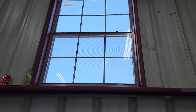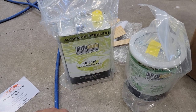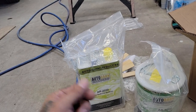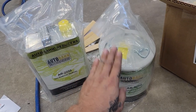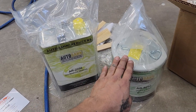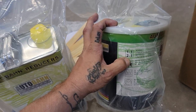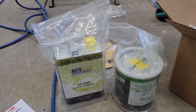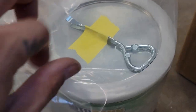The reducer I chose is medium. Here in Texas we've got some bipolar weather - one day nice and hot and sunny, next day a cold front - so I chose medium. I'm going to take this next project in parts. If you want better hide, you could reduce it by half: two parts paint, one part reducer, and that'll give you better coverage when you're painting.